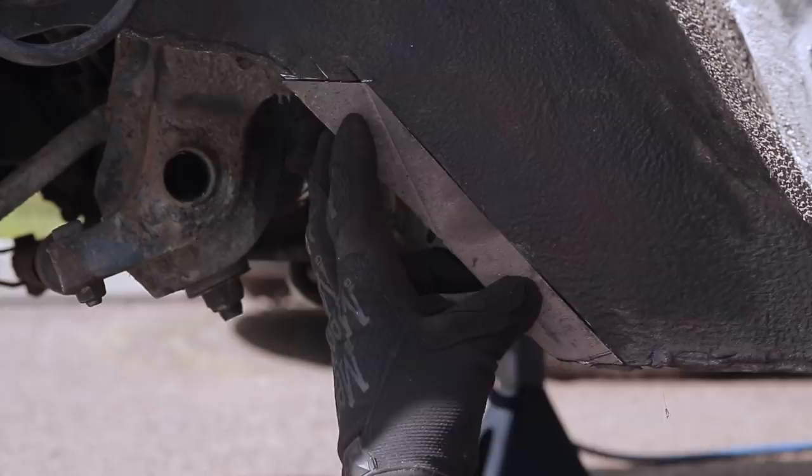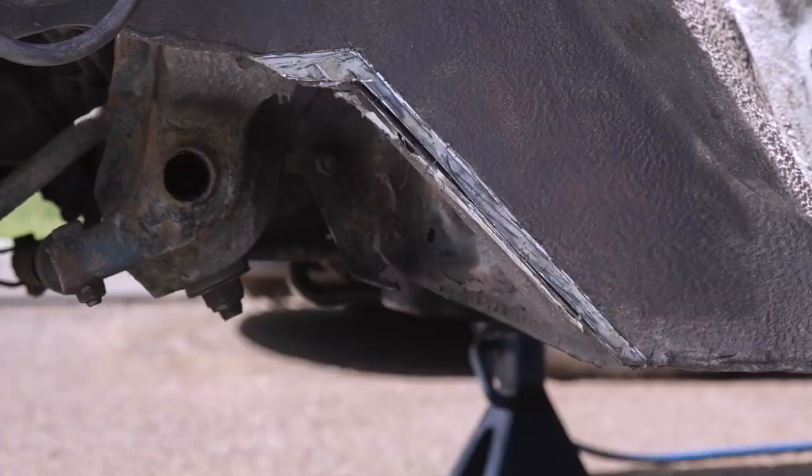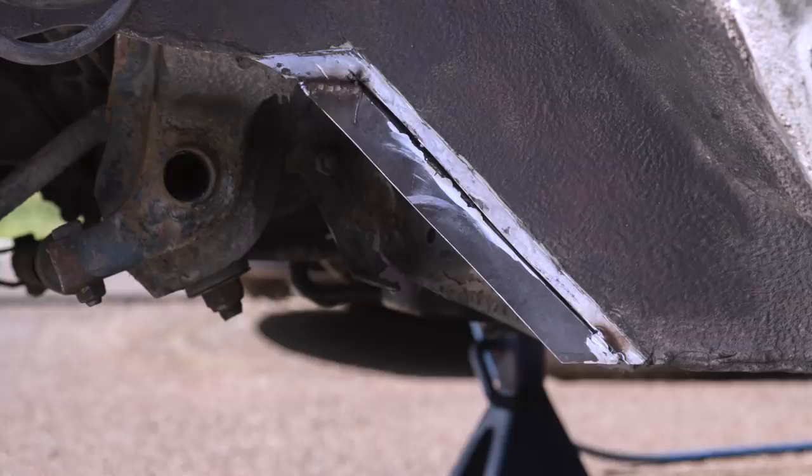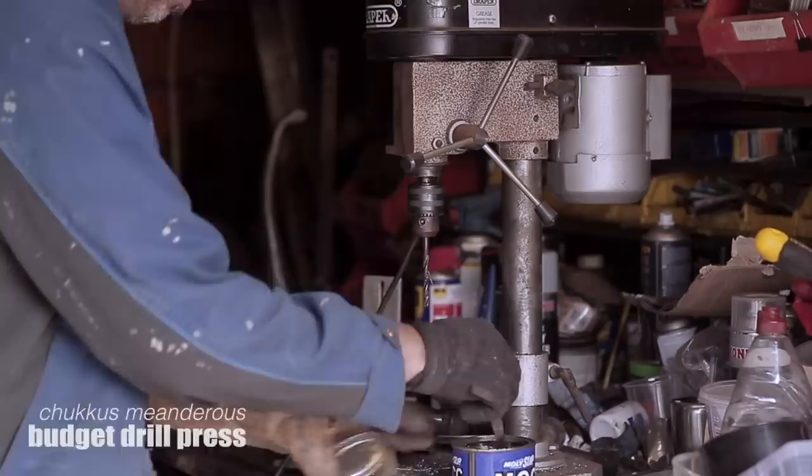And speaking of abrasive devices, now that we're finally into that metal work that I did in the front end, a finger sander, whether it be pneumatic or electric, is just a brilliant thing. It's great for cleaning up the edges of an area that's about to be welded. It's great for getting into tiny little nooks and crannies. And with a 40 grit belt on it, it will make short work of grinding down hard to reach welds.